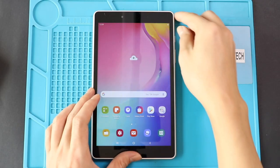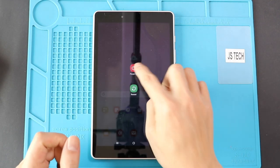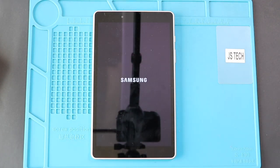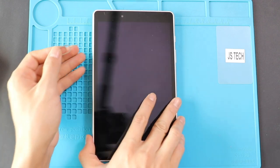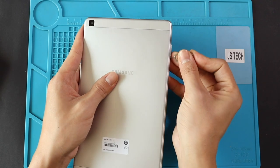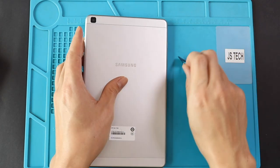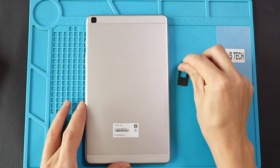Today we will show you how to replace the battery on Samsung Galaxy Tab 8.0 2018 T290 T295 models. To start, we need to have the right tools to proceed with the repair, which you can find in the description. First, turn off the tablet and take out the SIM tray, and then follow with the back cover removal.